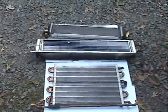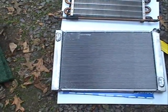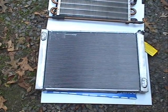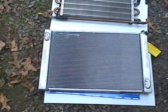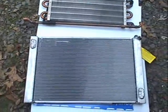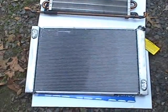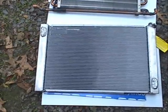So that's what the heat exchangers all look like. You can see there's a tremendous difference between the original, the bigger DIY one I made — which is almost two square feet — and this Summit Racing unit, which has a massive number of rows with one-inch aluminum tubes. It's about $170 from Summit Racing and looks to be the least restrictive with the most airflow and most fluid flow possible. I'm really expecting a real benefit when I run the Crossfire. I'm doing auto-crossing, so the engine runs at full power for up to a minute at a crack and gets pretty hot. I've actually had the BAS ESP light come on several times simply from the engine going over temp and shutting down while doing 40 miles an hour at full power — I'm just not getting enough cooling.